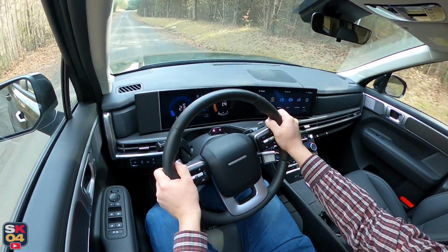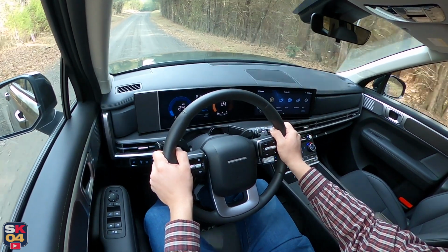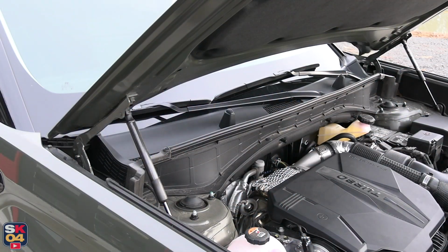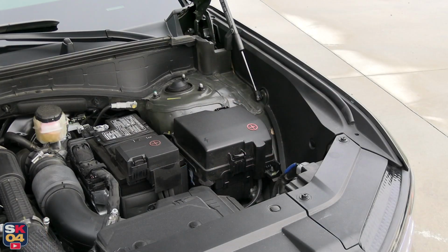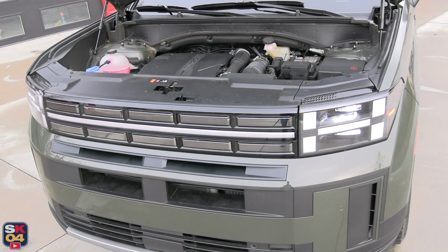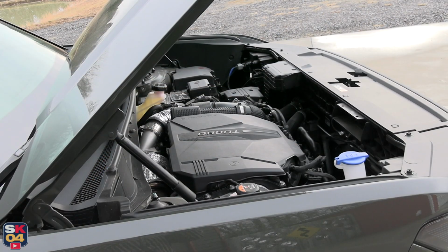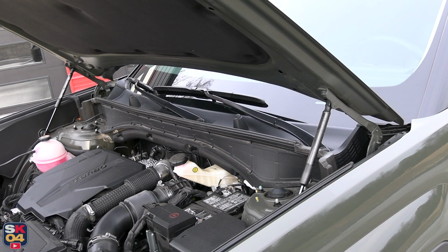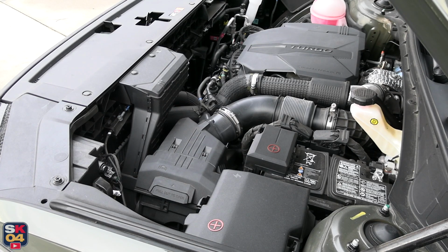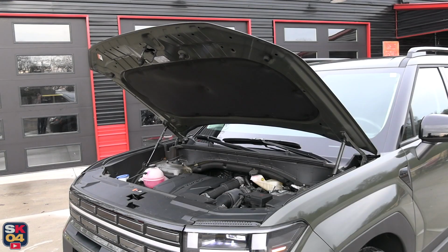As I mentioned earlier, except for the XRT, all-wheel drive is optional, while front-wheel drive is standard. The all-wheel drive system features an electronic variable torque split clutch with active torque control between the front and rear axles. The XRT's additional modes include Snow and all-wheel drive lock. They adjust powertrain behavior, all-wheel drive torque distribution, stability, and traction control settings accordingly. With all-wheel drive, Sport mode gives you a more agile feel by sending more available torque to the rear wheels for a sporty, dynamic feel when desired.